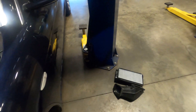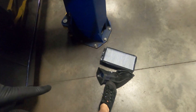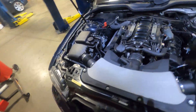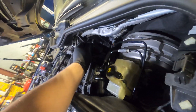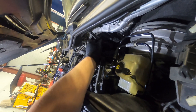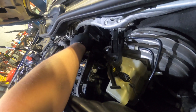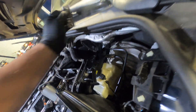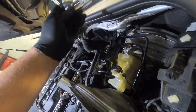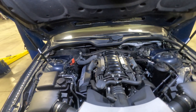To take this apart, you have to take the micro filter housings out — they just pop over a little clip; pull up on them and they snap off. They pull out of the intake hose into the box. On the other side, there's a clip that pinches against the body and screws into the side of the air duct. Undo that, then at the back of the air duct where it meets the box there's a metal clip across the top that you just pop up and pull the duct out. Note that on this car, the standoff with the screw is actually missing on one side.